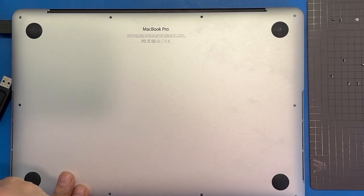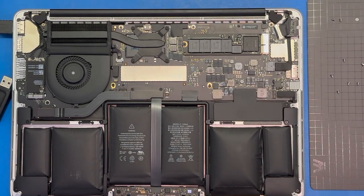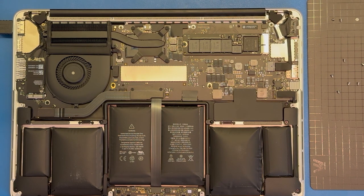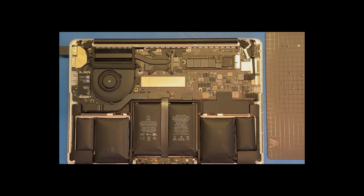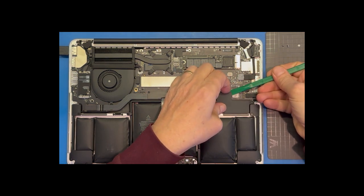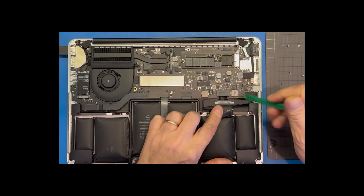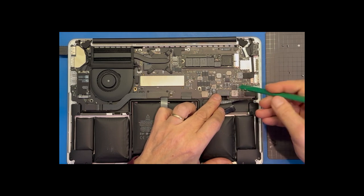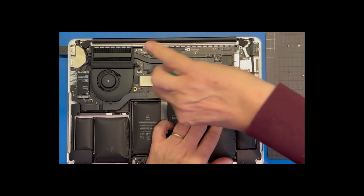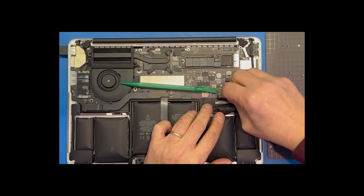And we are in, as the hackers say. We have the beauty of the thing. We properly shut this down before we did this — we don't just want it in sleep mode, we want it completely shut down. So we need to now remove the battery connector, which is under this sticker right here. Just lever that, peel this back a bit, and gently lever that out. Then bend it back so it doesn't touch.